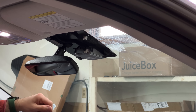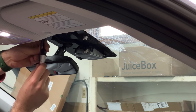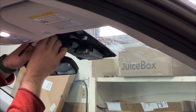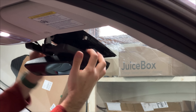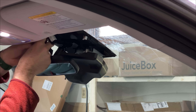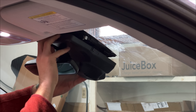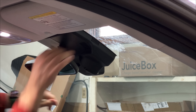So now we will take the new adapter from FitCam, disconnect this, and plug the female side onto that connector — just like so. Now we can go ahead and plug the other side of that connector into the mirror. All you've got to do now is push this over your mirror, make that power connection between the two cables. You do have to rotate that cable to get the pins to line up, then just give that a nice firm push together. Then just push that back up towards the roof — and that's it, that's on there.